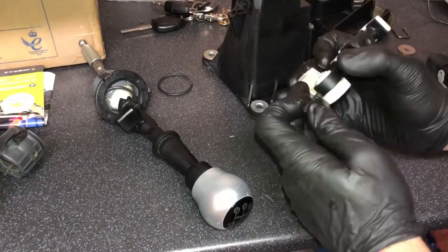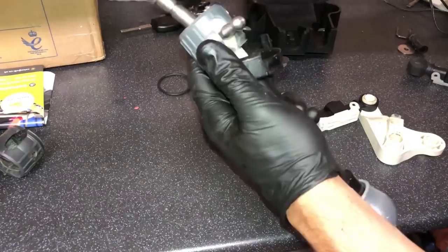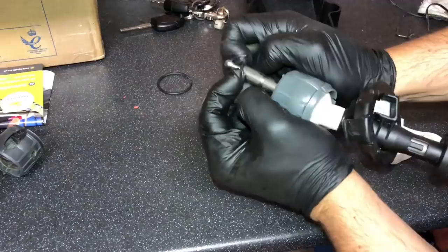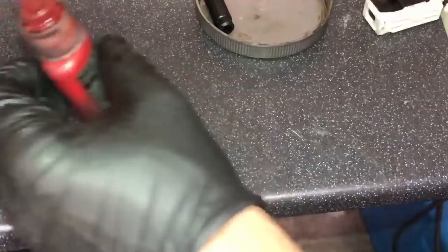On the other side of the gear selector there's a spring that goes in here — it's full of old grease, dirty over the years, and it's got the roller bearing part on it. Just clean that out and put some new grease in it. In the kit you have two more bits left: this is the O-ring, and this part goes around here — these normally split so they're often not even on there. Replace the quick shifter if you've got one; if not, it just slots straight over. The O-ring sits up here, and that goes back over the top. Remember to do the grub screws up with some Loctite because they have a tendency to come undone and cause play in the stick.